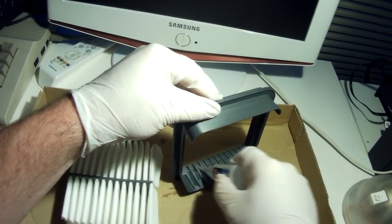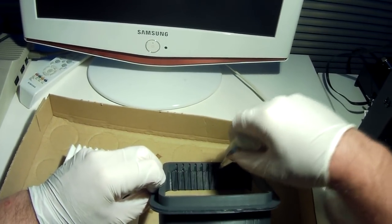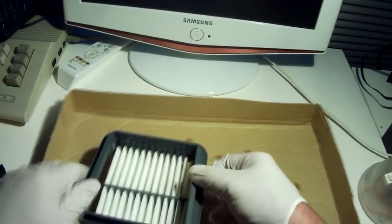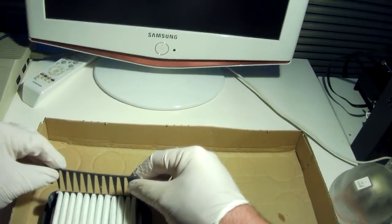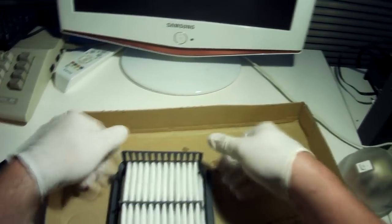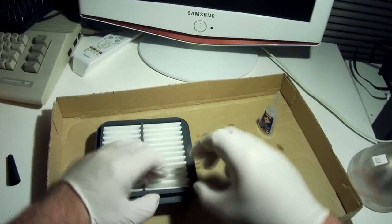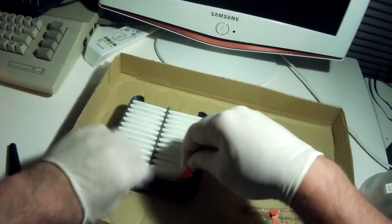With this now together, I want to fit the filtration material into it. I use glue in the grooves to make sure it'll all be sealed together, and then I take the core, which I've trimmed exactly to fit the internal dimensions of the housing, and it just slides home with a good firm push. To make sure the material is secure and sealed into the housing, I then use these comb-like pieces that I printed to mate into the grooves from underneath — again glued and pushed home — sandwiching the filtration material firmly in place in the right alignment.